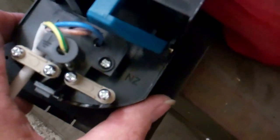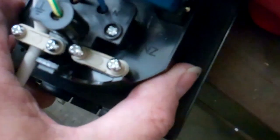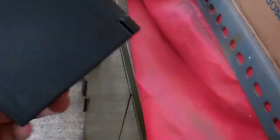Right, so I don't know if you can see it, but where neutral is, it's got an N. Probably can't see it, the light's terrible in my garage. It's got an N for neutral. Other side, it's got an L1 plus, with brown goes in, so that's live number 1 positive, and it's got earth there where the middle wire comes in. So once them 3 wires are in the right place, and like I say, you can't go wrong because it's identified.